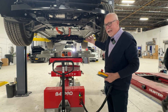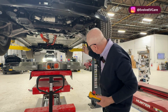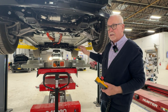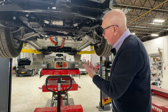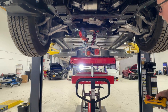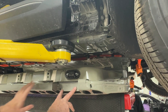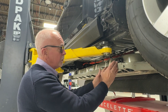We're going to bring this battery up and make the connection — it's essentially just mounting points. This vehicle does have pinch welds, very much like a traditional vehicle, where Teslas don't have those pinch welds, making it a little more challenging to mate the battery. On a Tesla the mating process is very simple but you have to be super precise, whereas here it's bulkier. There are cutouts to access the pinch weld at the front and one in the back as well.